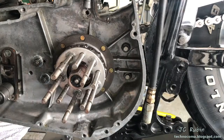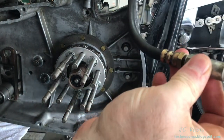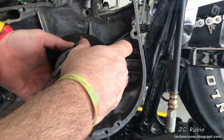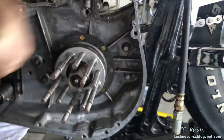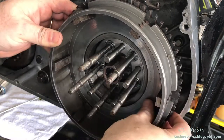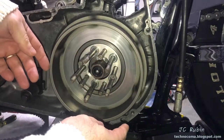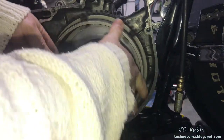My footage of me cleaning and mounting the clutch hub was lost, but I'm going to be removing it anyway when the new parts arrive for the kit. Right now I'm just going to grease the bearings — everything was cleaned out with kerosene so it's all completely degreased. I apply a very light amount of grease to each of the bearings. This clutch hub is about 10 years old and I've had no problems with it in this dry clutch setup. I apply the lightest silhouette of grease to the bearing surface on the inside of the basket, place the basket carefully over the clutch hub and bearings, seat it all the way down, and give it a couple of turns back and forth to evenly distribute the grease. Everything's smooth — no wiggle, no looseness.